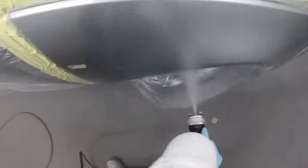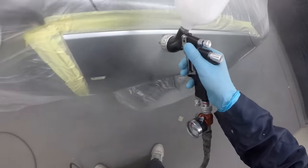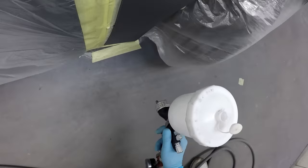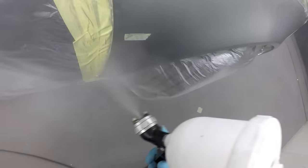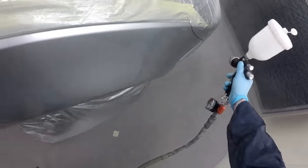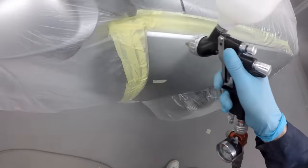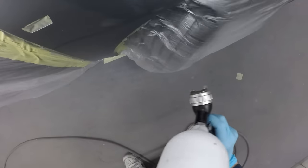I can gauge the finish and add to it a little bit — if it looks a bit too dry for what the Vauxhall is from factory, I can slow down and wet it up a little. It's all about your gun and how you spray: your distance, air pressure, viscosity of the paint — everything comes into account for the final finish. With my clear coat mixed the way I've got it and this setup, I can pretty much go for any factory finish I want just by altering my actual spraying style on the job itself.